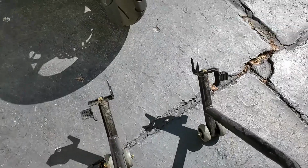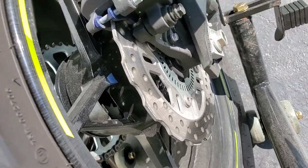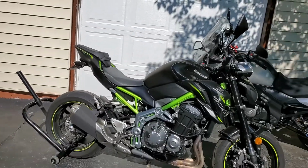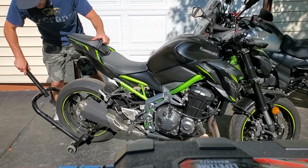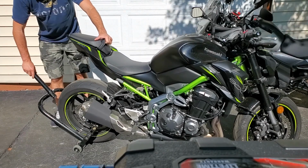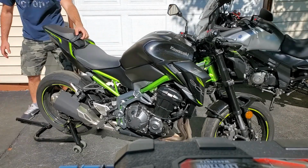So you're going to come up. You're going to line each of these parts with the spool sliders. As you can see, they're not going to line up right now because you need to have the bike straight, which is why it's easier if you have somebody else to help you, but I'll at least need two hands while I'm doing it. So you hold the bike straight with one hand, line these up on either side with the other hand, make sure you got both of them good, start applying some pressure, and it's just going to lift up and back. Then you set it down.